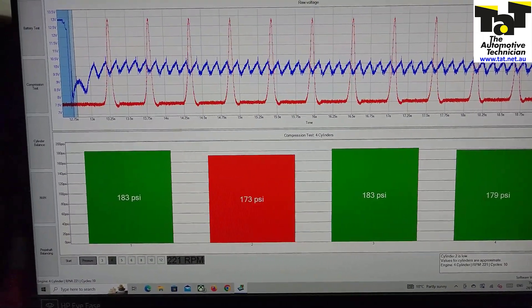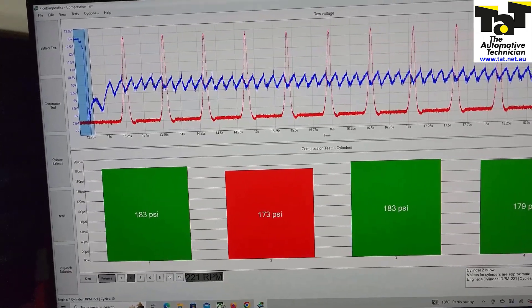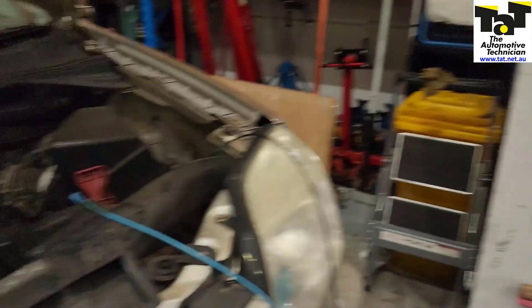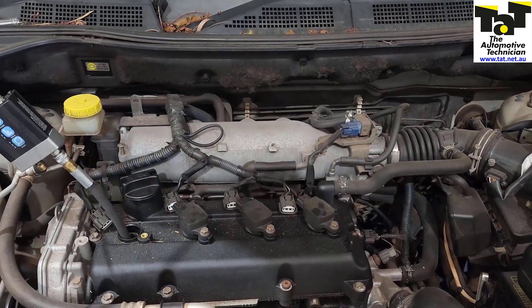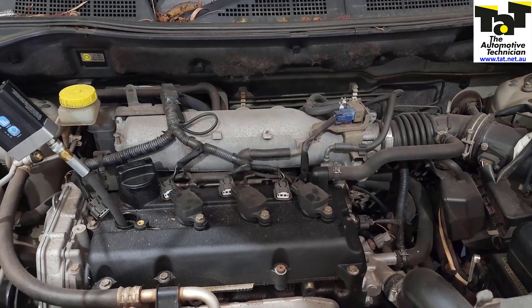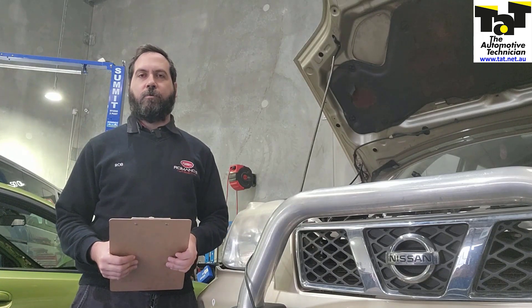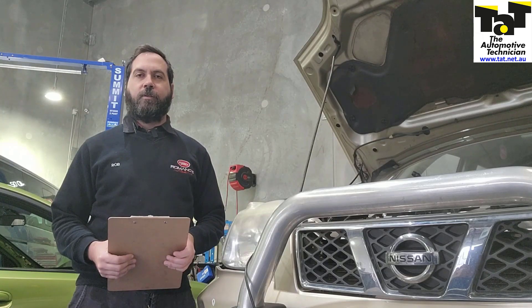This is the first one I've used, so there's probably a little bit of playing around with it. If you get a low cylinder, you need to determine which one it is, but once you get to that point, if you're handy with the tools you know where to go further. It's a very simple and quick test, and on this engine the spark plug is extremely easy to get to — it's not always going to be the case. But if you need some numbers, this is a pretty easy test compared to ripping out every single spark plug and doing it one at a time. If it's hard to get to a spark plug or glow plug, hopefully you can just get one and do this test. Not knowing with a relative compression test if compressions are really high or really low, this is a great test to add to your arsenal for diagnosis. Thanks for watching and we'll see you next time.